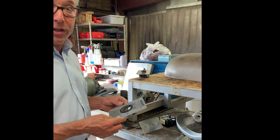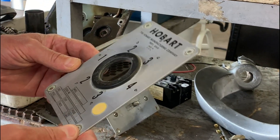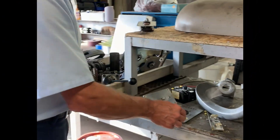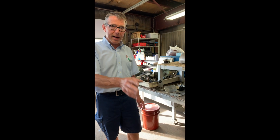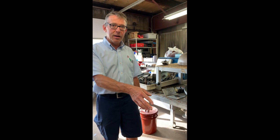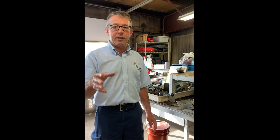When we talk about mixer voltages, this is the spec plate off the machine — it has the voltage and the phase. Earlier Hobart models, this is the H-Series, were voltage specific. You buy one, you have to make sure you get the voltage and phase that matches the electrical service in your building. When you're on eBay, nobody's asking you what voltage or phase you need, or what application you're using it for. When you buy it from us, our consultants will make sure they ask you all that and make sure you get the right machine for your facility and for the job you need to do.